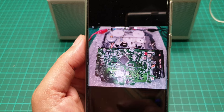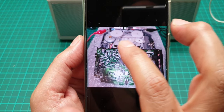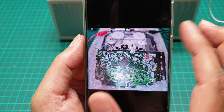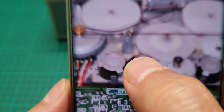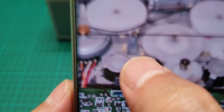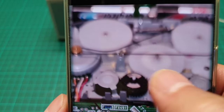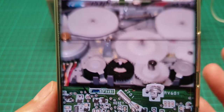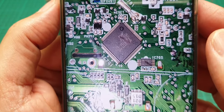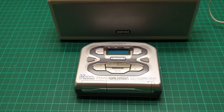This shows how to put a belt in there. The transport system is down there, and the metal parts — unfortunately all the grease they put in there had hardened a little bit, and I had to strip it apart completely and wash the whole transport system with alcohol and put it all back together again.